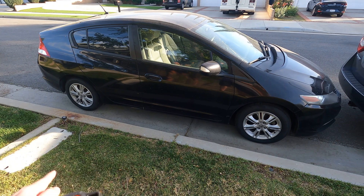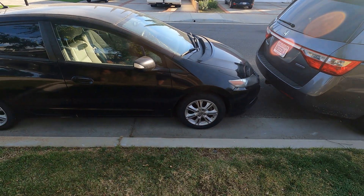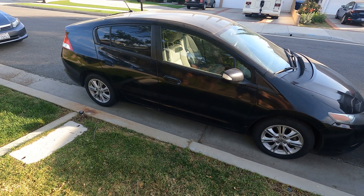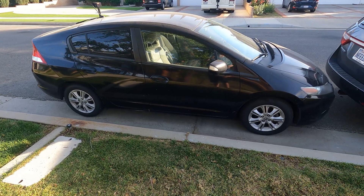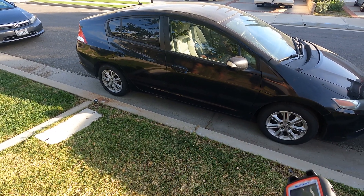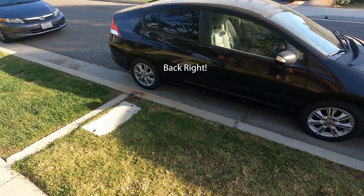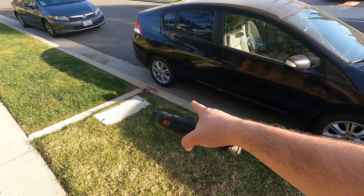Since this car is 12 years old, these sensors on each tire only last anywhere between five to seven years — though on this vehicle they seem to last at least 10 years. What I didn't know was which sensor was having issues. You can take it to a place where you get your tires and they can check them all and tell you which one is faulty. In my case, I found out the back left was the only one with a dead battery, so it wasn't registering.